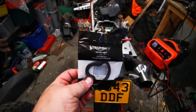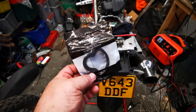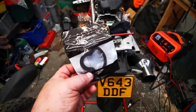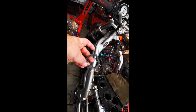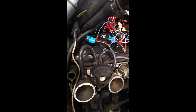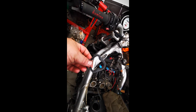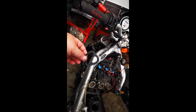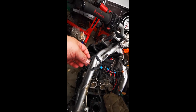It's another new day — ordered yesterday from Fowlers, arrived the next day. So I'll stick the seal on the stepper motor and crack on. The seal has a flat side and a grooved side, and the grooved side sits up against that bit of plastic that goes around the stepper motor. I'm actually going to put some grease on this as well to give a nice tight, sticky fit, and then stick the airbox back on.